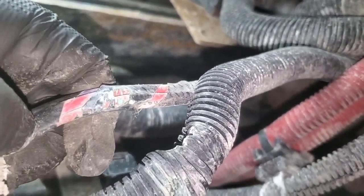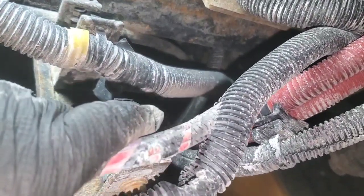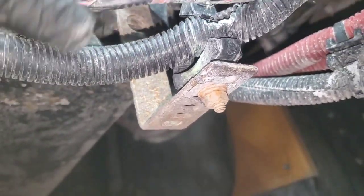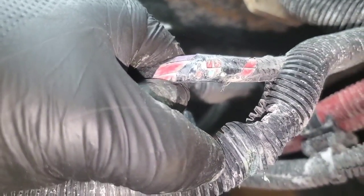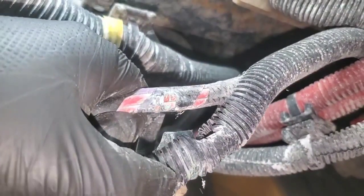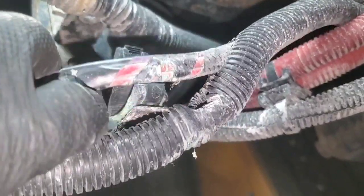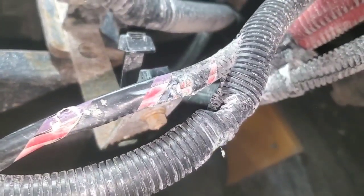So that's good — that was a quick, easy find. These wiring ones aren't bad once you figure out what to look for. A simple inspection and you can see a little bit of green sitting there — well, you know something's not right. That's guaranteed to be our problem. I'm going to fix this wire and retest for the code. Most likely it'll go inactive and we're good. Hopefully this helps someone who's trying to find this issue or diagnose this code.